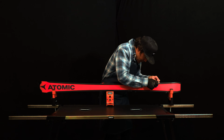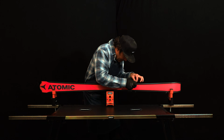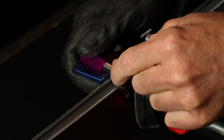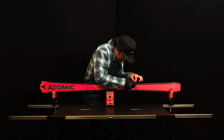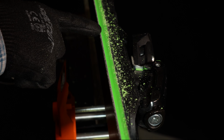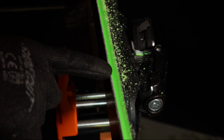Keep your sidewall remover fairly close to you with your elbow bent, and maintain the exact same speed by walking with your tool. Try using your forefinger and thumb to pinch the stainless steel pin for enhanced precision and minimize vibration. This will help eliminate the potential for chatter marks on your sidewall.